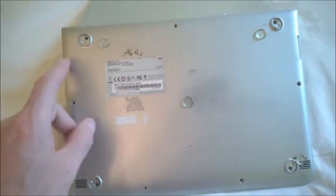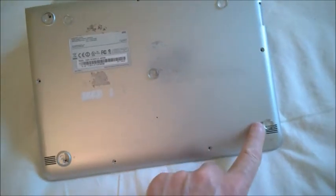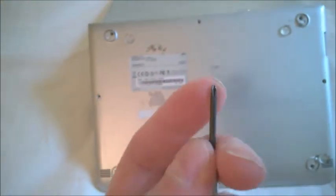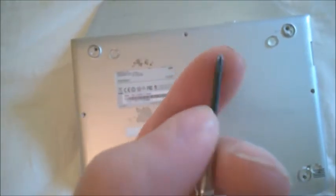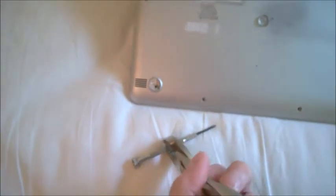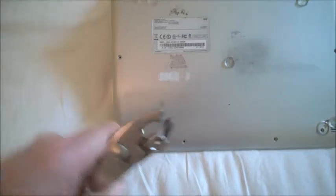To remove the parts, first remove the rubber pads on the corners, then the trackpad side. You have four screws — two on the side and two to three more — these are tiny screws that require a small Phillips head screwdriver. You really need one that fits deep into the screw, not just at the surface. Because the screws will be stuck, use a pair of pliers to grab your screwdriver and give it a kick with a little pressure to break it loose, then unscrew it.